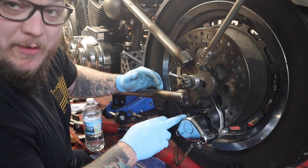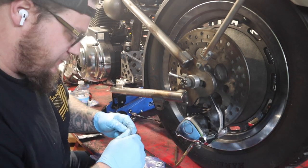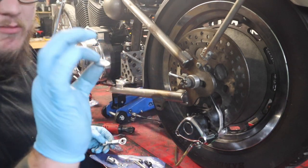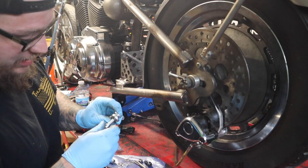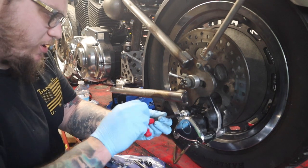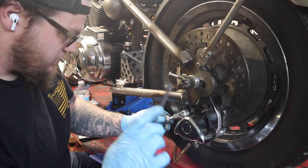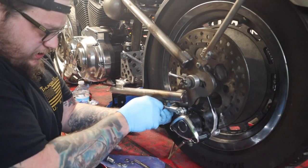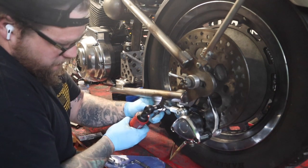As you previously saw, I've cut all the extra crap off, drilled and tapped this hole — 3/8 by 16. So this is how it's going to mount. In the TC Bros kit bag of hardware, it came with this heim joint, and it also came with this heim joint spacer — looks like a little dished washer basically. You're going to take the 3/8 by 16 bolt through the heim joint, through the spacer, with the flat side of the spacer on the caliper, and thread that in. I'm going to eventually get all ARP hardware — probably chrome ARP hardware for all this. Make sure your bolt's not too long, otherwise it will rub on the caliper. The other bolt goes through the heim joint through this slot, and the beauty of this heim joint is that you can lengthen or shorten it as much as you want to get it to fit how you need.